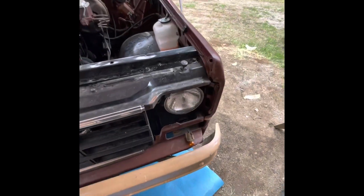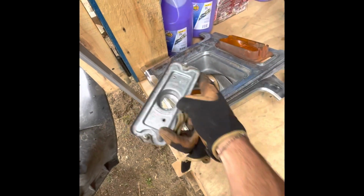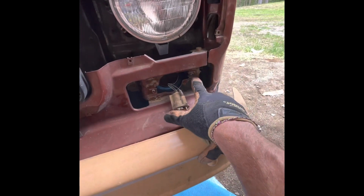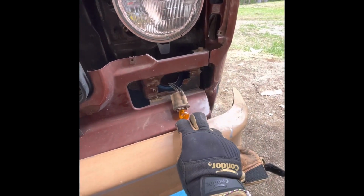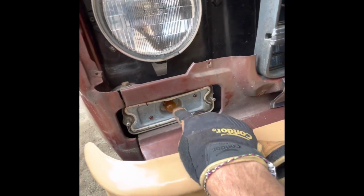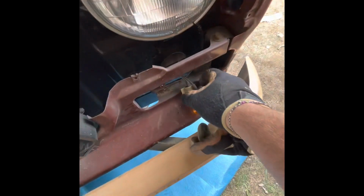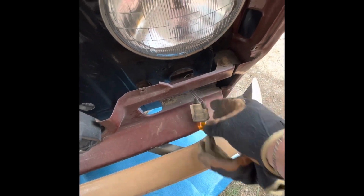All right, so pulled that piece off, which I have sitting right here. It's literally all it is, and it just goes to where the lens is. But yeah, so these 2 bolts right here are 9/32. I always know that because they're in between 1/4 and 5/16. So these 2 right here, and then the light bulb. So once you pop this off and you get it out, this back piece right here, literally just twist it and it unscrews.